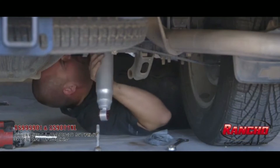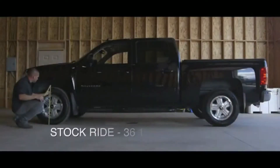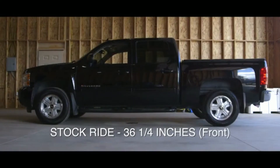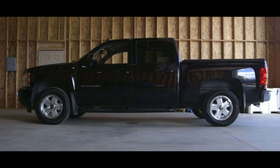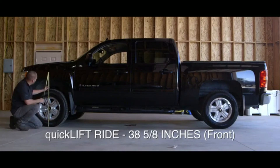And to kill three birds with one stone — new replacement heavy-duty shock, fresh new coil spring — the Quick Lift Loaded will also help level out the vehicle's stance, as this particular set comes from Rancho ready to give the Silverado an additional 1.5 inches to 2.25 inches of lift in the front. The variance all depends on the condition of the strut assembly it's replacing.